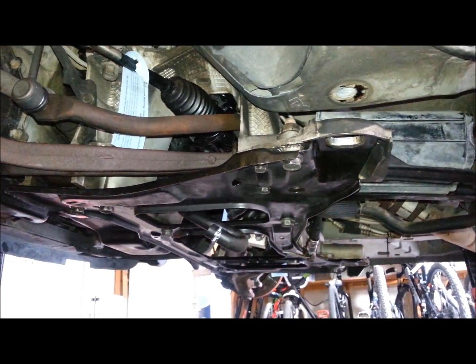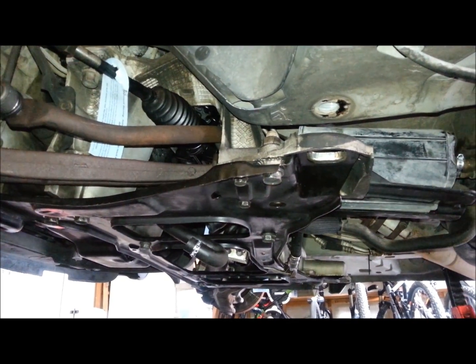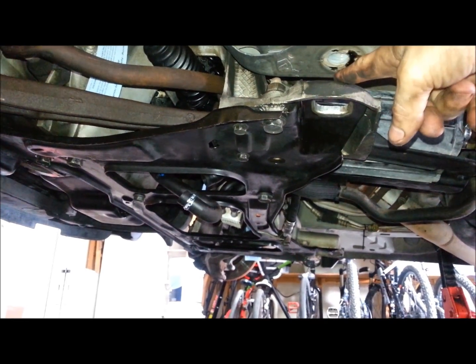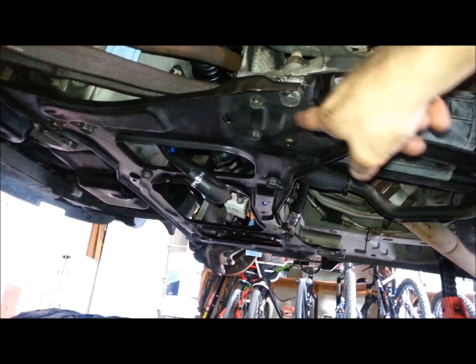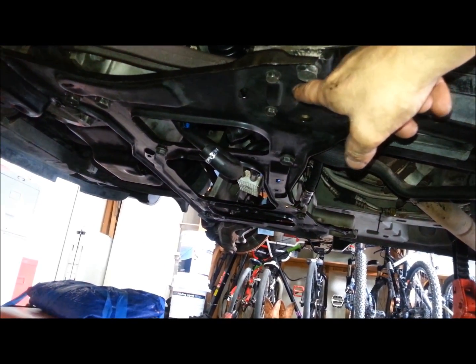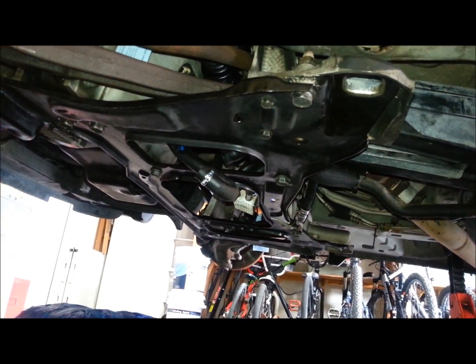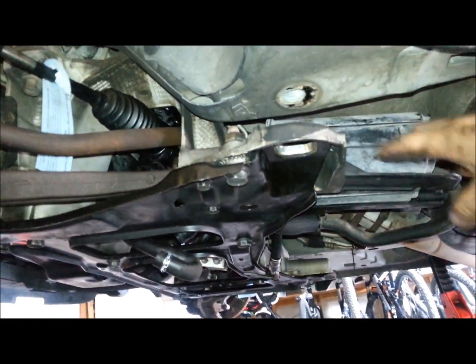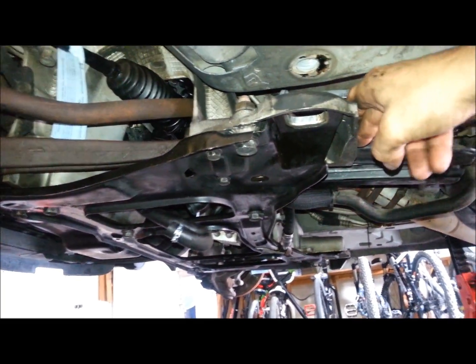So I say, after you pull the splines out, the shaft out from underneath the dash, pull the mounts on this side and the other, get rid of this plate. It'll be easier to drop the rack out than trying to wiggle it through the hole like they say, which is a pain in the ass. And also, when you loosen this carriage and bend it down, it'll be easier to get this canister off, and it'll give you more room up underneath there.